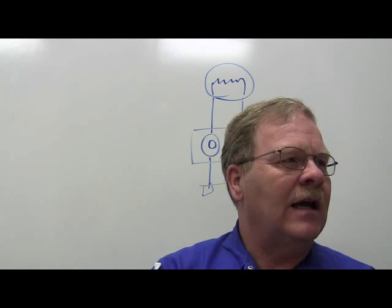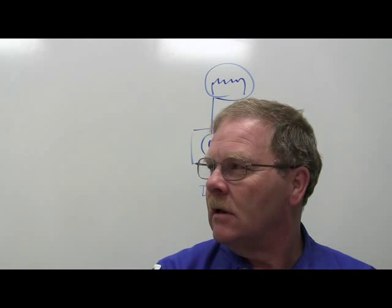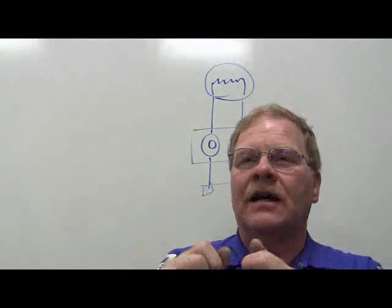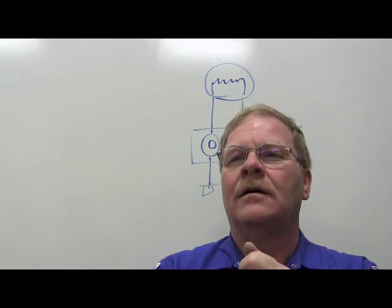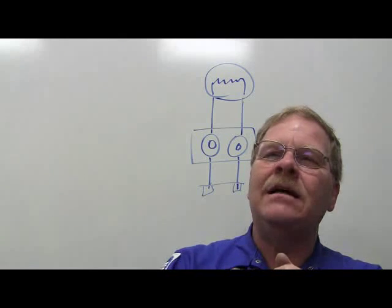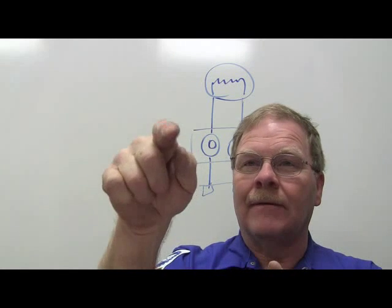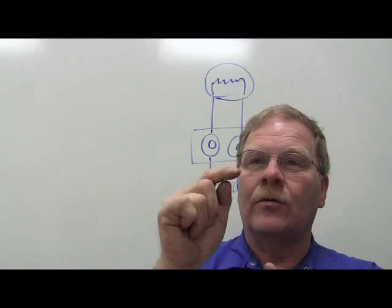Has anybody got a rain gauge at home? I'm talking about one of them little rain gauges that's got straight sides. I know you do, Mr. Farmer. All right, you take a tape measure and you mark it with 10 even graduations, right? Then you're going to pour that thing 90% full of the gasoline that you're testing. And then you're going to pour the other 10% with water.